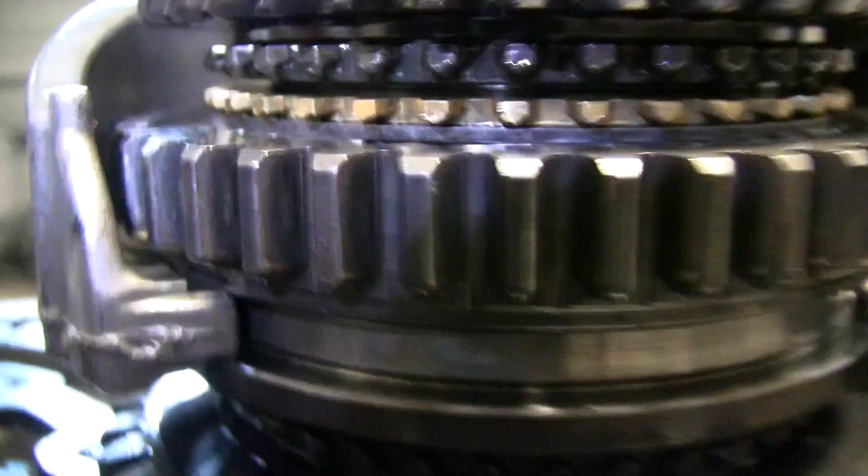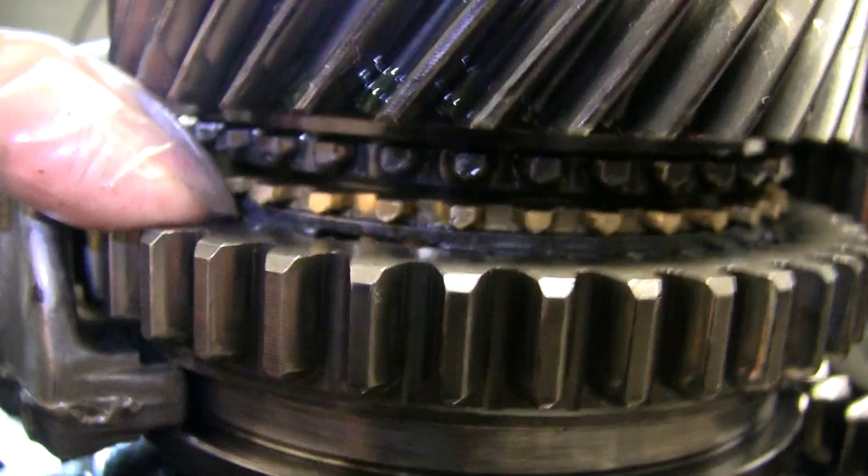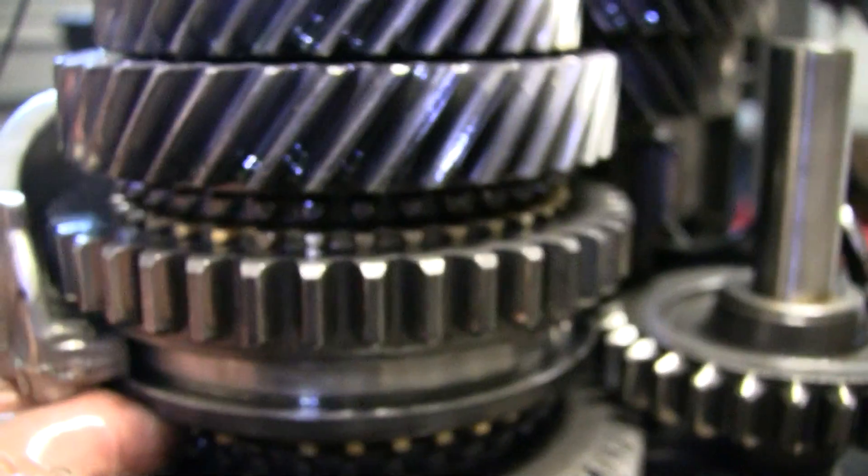You can see the rough edges. The bottom one right here is the spring. Now when it's spinning, regardless of how much light pressure it puts on, it's not going to slow the gear down anymore. The gear is still spinning at full speed when you're catching it — when you're shifting into gear — and that's why it's grinding gears.